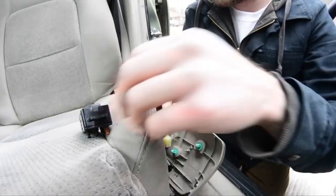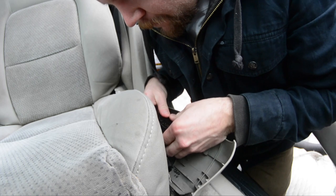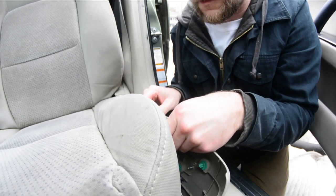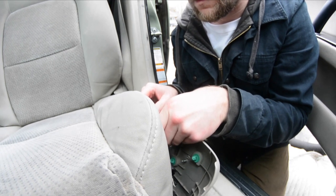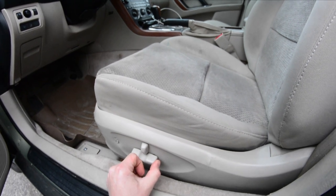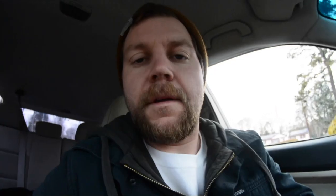Let's test it out — oh yeah, there it is! Forward, back — it works! That's it. I know this isn't going to work for everybody, but for someone with the same issue this video might help. If you have more than one function not working, at least now you know how the switch comes apart and can clean whatever you need. Hopefully it saves someone some money instead of paying $70 for a new switch — you can just take it apart and clean it in 10 minutes with about three tools. Any questions, leave a comment below. Thanks for watching!